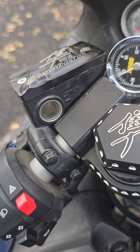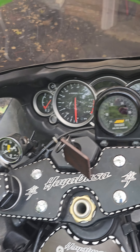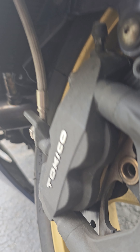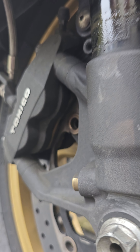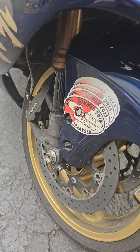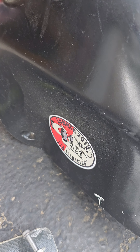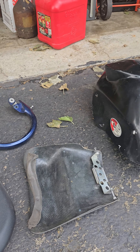The clutch and the brakes were all bled completely and redone at the same time the brake lines were done. These are the EBC not normal HH sintered pads, but the race ones — they will make this thing stop on a dime. These are actually from the previous owner David Thompson, who raced with number 9166. His son had 9168. This is a land speed record front fender, Montgomery Racing low cut seat.